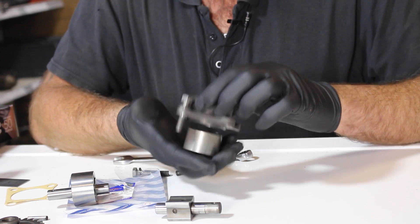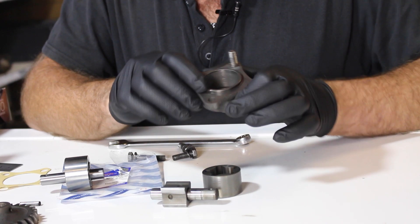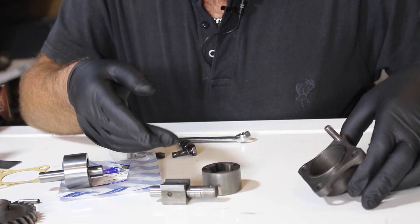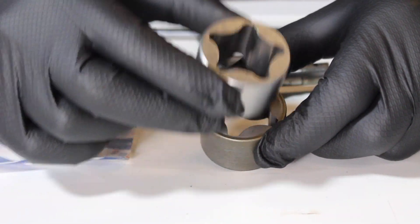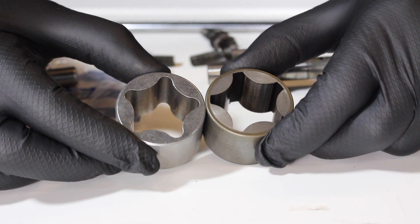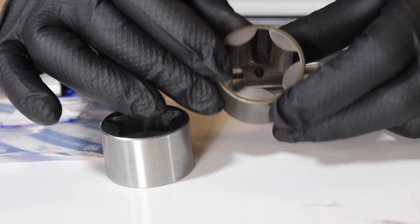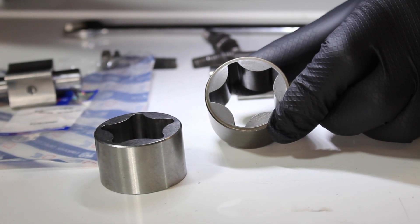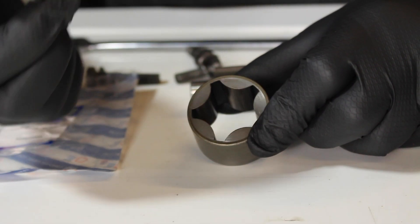That bit comes out, and then that piece — and obviously there's the oil pump casing. If we remember, when we first started it had been sandblasted at some point in its life and that sand got everywhere. Here's the original one, and you can see all the little scores in there from where sand and muck and material have gone over the years. The inside of it is very worn where the sand and different bits of material have gone around it.